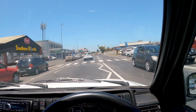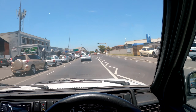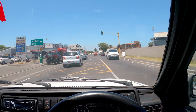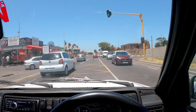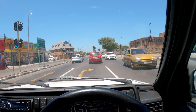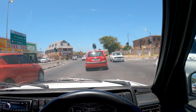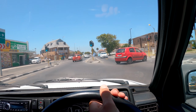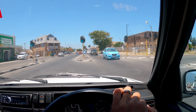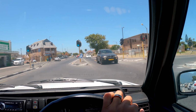That's basically an extension of the oil filler cap that becomes a breather, but we have an issue because it's too tall, so it's actually touching the bonnet. My friend Andrew is going to help me make some sort of ghetto hack and cut it up and try and get it to work, and hopefully it will reduce blow-by. So let's see what happens.